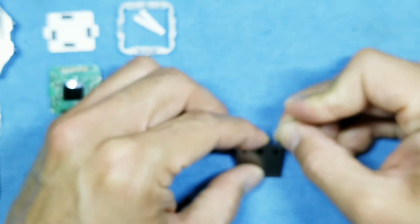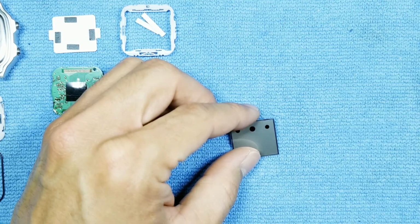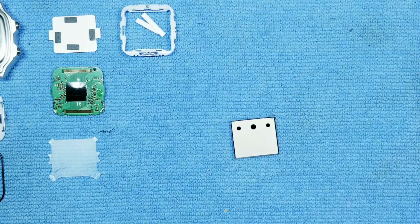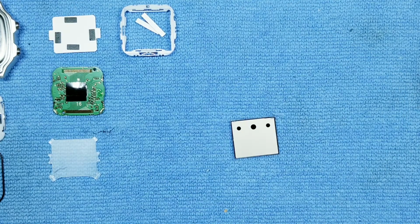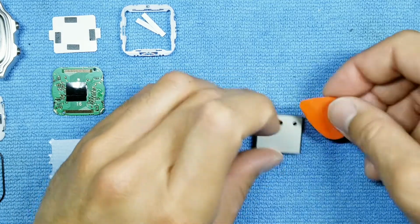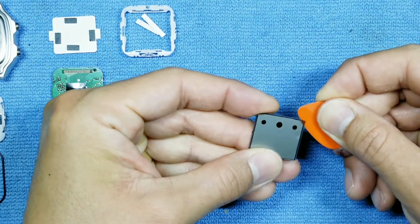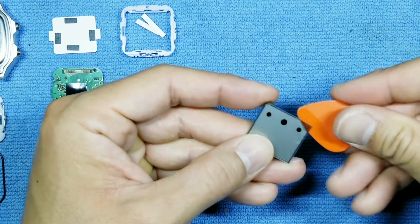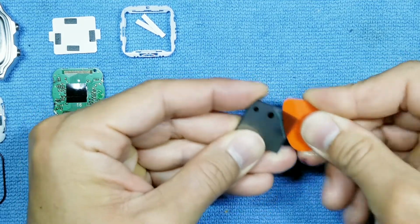Okay, once you create that air bubble, we'll put the pin down. Go ahead and take your guitar pick, dip it in a little bit of Goo Gone. So I have a bowl here filled with a little bit of Goo Gone. This is what the bottle looks like. Okay, dip one of those edges into the Goo Gone, stick it right where you made that air bubble, and then gently rock it back and forth. What you're going to do is slowly separate that top polarized film from the middle layer.